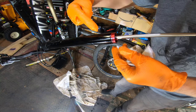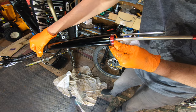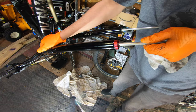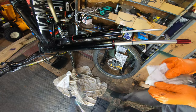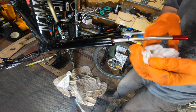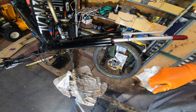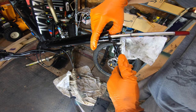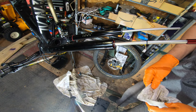What's happening is we've got a good seal in there, so as I push it in, the little bit of air that's trapped in there is pushing back on me. By releasing the air and pushing the shaft in, we'll be able to pop it in there. Now we should be able to put the retaining ring back in without any issues — retaining ring back in — and we are ready to get the lowers back on.